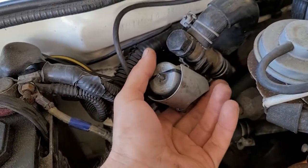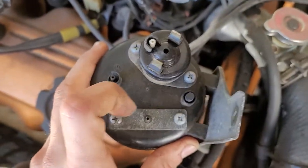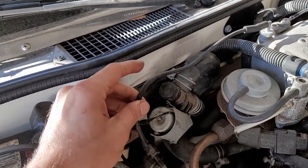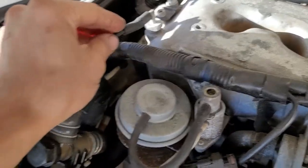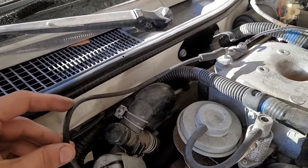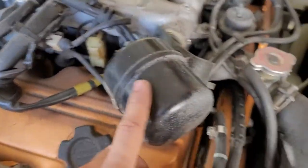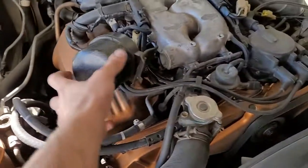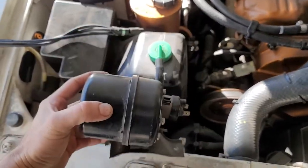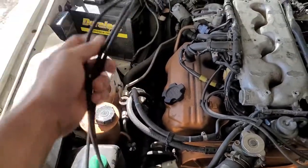It holds the valve from the bottom. The other hose that goes into the firewall used to go directly into the vacuum pump. What I did is I cut it and bypassed it directly into the intake manifold, so I get the vacuum needed inside the car — which actually increased by a lot. I can tell the vacuum is much better. I had this guy bad and like I said I want to remove everything taking space on my car, so one, two, boom — goodbye. We don't like a lot of hoses on the Z, so goodbye.